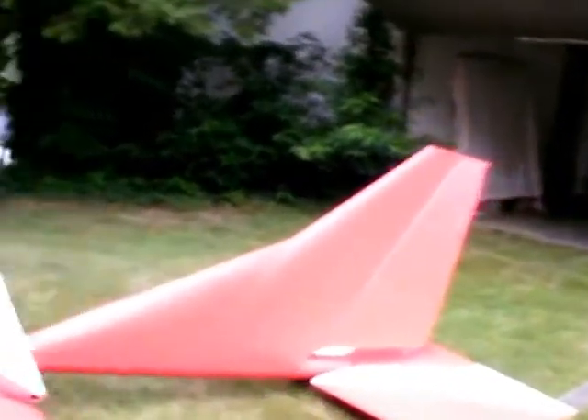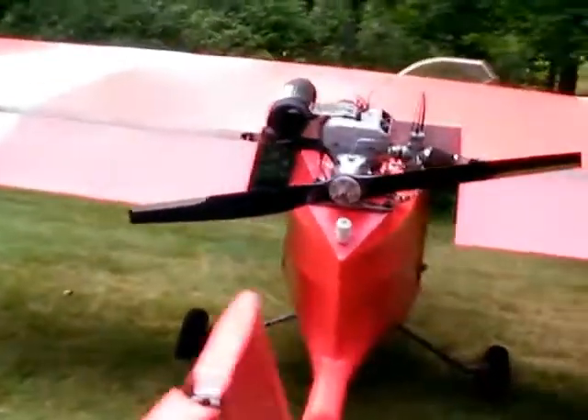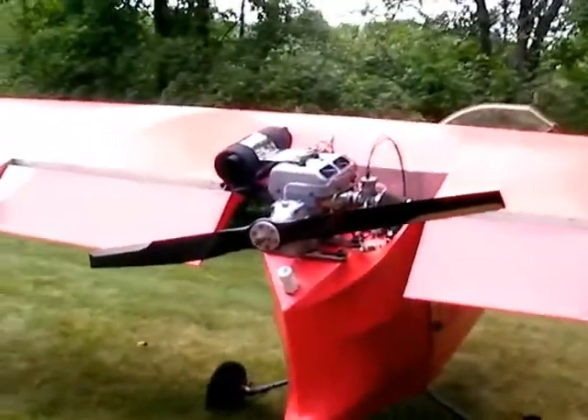Pre-flight would be the standard stuff you do on any aircraft, and you'll find that this one is pretty easy — everything you can get at and see pretty good. The only thing I'd want to look at real close before I fly it would be these bolts down here. This is a Jesus bolt — you don't want these things to come off because, Jesus, if that came off, this whole stabilator would come off. They've got a cotter pin in them so they're not likely to come off, but it's something you can check just by looking at it walking around the plane. This time I came in and landed with full flaps and actually came in pretty good.